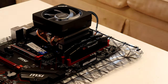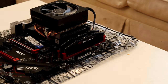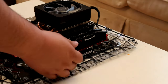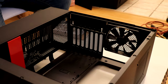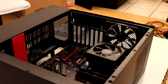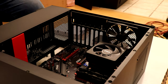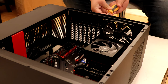Since I have an M.2 SSD, this is easier outside the case. Grab the screw that comes in your motherboard box and screw it in — you may need a smaller screwdriver for the M.2 screw. With enough fiddling it should work, and boom — M.2 drive complete. Up next is the case: open it up and find the little components inside such as screws and mounts. Grab your motherboard I/O shield and place it in the back of the case, then carefully place the motherboard in, lining up the holes and aligning with the I/O shield. Once aligned, screw in the motherboard and you're done with that part.